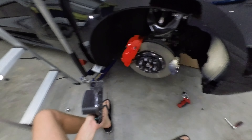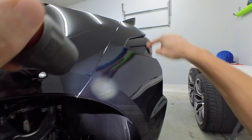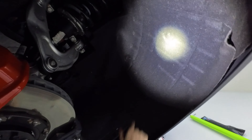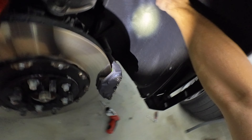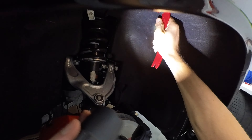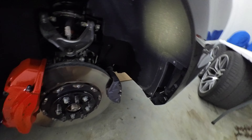We got the rear wheels off. We've had the C8 rear bumper off before. I haven't done the Z06 yet, but I think it's probably something similar. I remember last time we had to pull these mud flaps off, pull the inner liner out, and there were three screws right up in here that we had to get to. But first we're going to start at the top. I believe there's about 16 screws. You guys are probably rocking T15s here. I've got Phillips screws with buttons in them because I'm rocking the C8 rally driver front cover. I might need to take out two T15s.